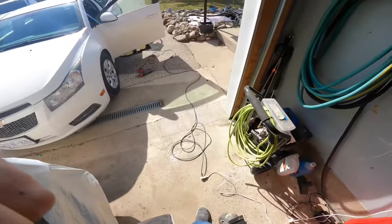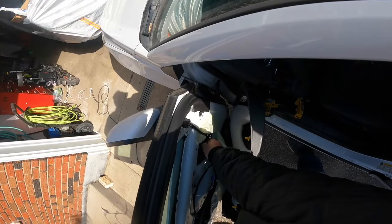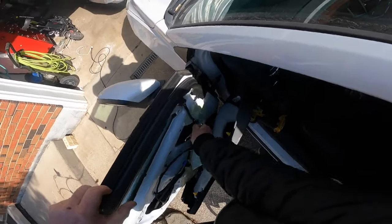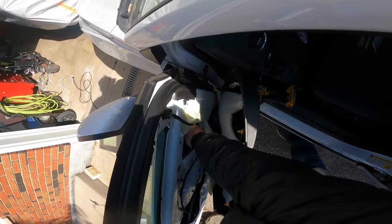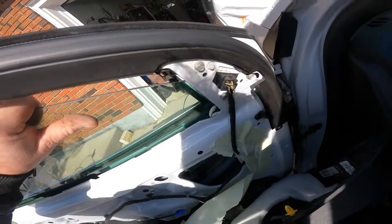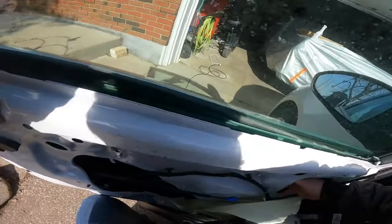So 10 mil. Over. Under. I'm surprised they come out of there. Those are tight. You can't go too tight on these or you'll break the glass. They're like a happy medium. They don't come loose because they're Loctited. Like I said, when they freeze, there's a lot of force on these regulators, and if they're too tight, snap-a-rooski.